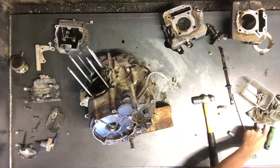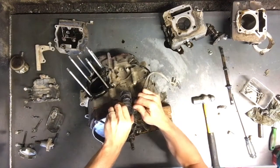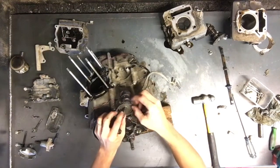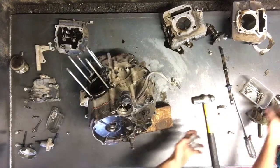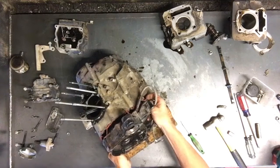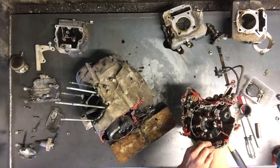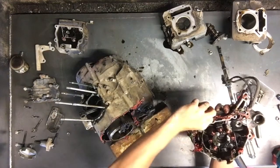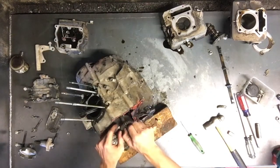We'll go around and pull all the 8mm bolts holding this stator cover on. There's an idler gear here behind this starter, and that little cover there — there's the idler gear. We just walked it off there. There's the stator. Like I said, this would have been resealed at one time. Parts are still good, but we'll inspect those and test them. Here's the other idler gear here.